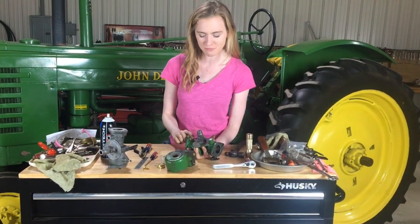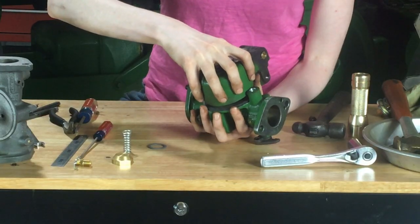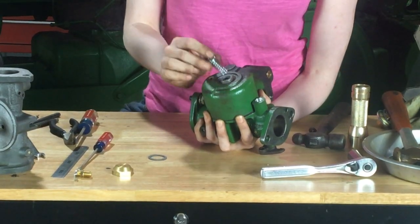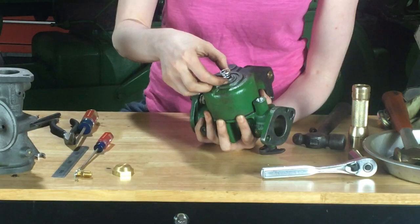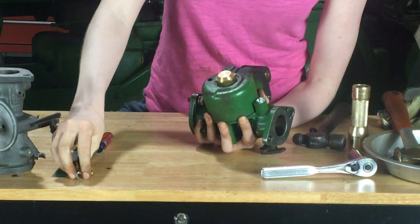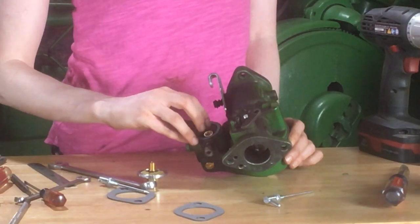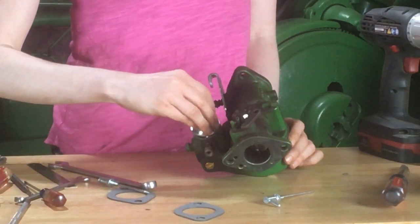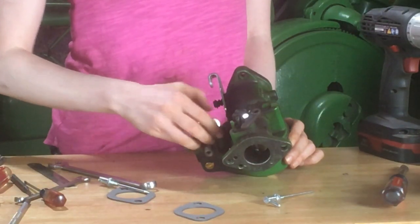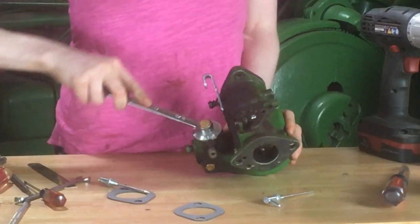There's a bolt with a washer that has to go on before you put the bowl onto the carburetor — don't forget that. Here you can put your gasket on and then your bowl. Next, you'll use the spring — notice that it's directional and the wider part comes up towards the top. Again, there's a gasket here, and then your nut can go on the end to secure that and tighten it up. Once that's tight, you can put your drain plug in. Put on the new gasket, make sure it's lined up, and then put this new screen on. Lots of times these screens get really nasty, so it's a good idea to replace those. Screw that all the way down — this is 9/16ths size on my carburetor.